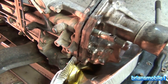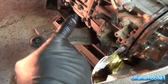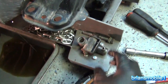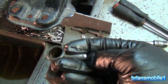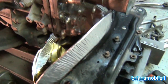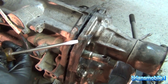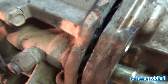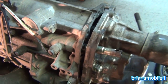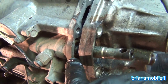Awesome, so we're making some progress on this shift shaft seal — that's fun to say. I've got a pie tin bent up in there draining off because any residual oil that didn't drain is going to come out this way. Getting it off is a pain — there's a big fat roll pin and then a thinner roll pin inside it and things just got stuck. There's a teeny little low spot where it's high here — I hit it and you can see a tiny scratch mark there. That's how I got it started, then just popped it the rest of the way off. Now it's good to go, and once that's off I can get in close enough to get that seal with the seal puller.